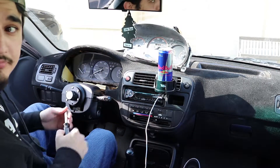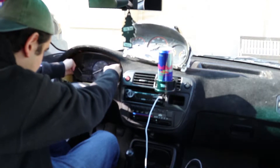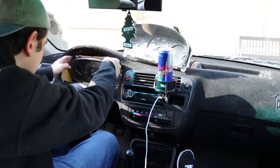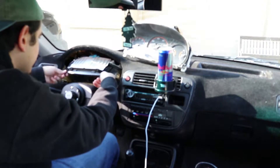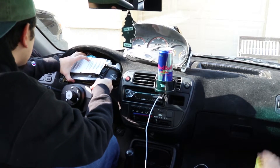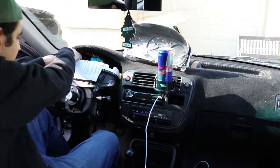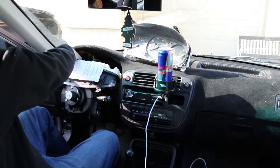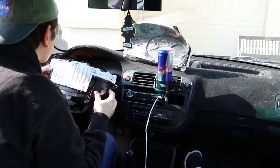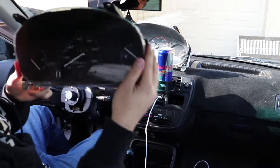So I got all four screws out, and I'm just going to take this out slowly — you don't want to ruin your clear plastic part. I'm going around this and I have to angle it down a little bit. Just pull it out. Let me disconnect these two plugs. There should be three plugs on here if you have a 97 and it doesn't have cruise control or anything, because I think that's what the fourth one is. And there's a yellow one down here. Cluster is out.